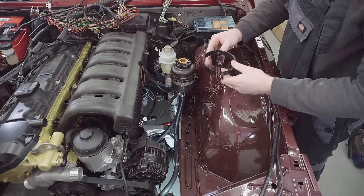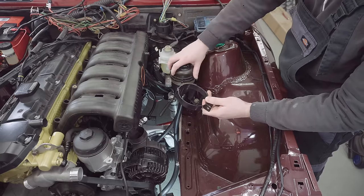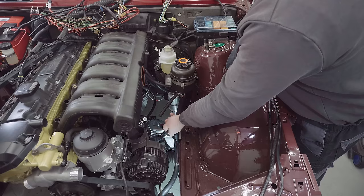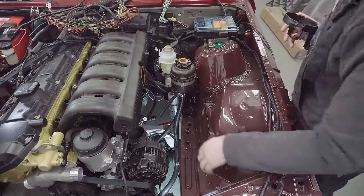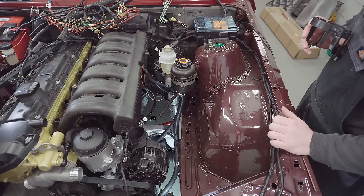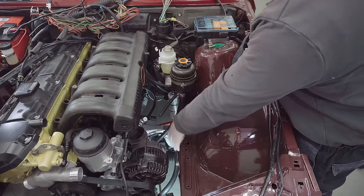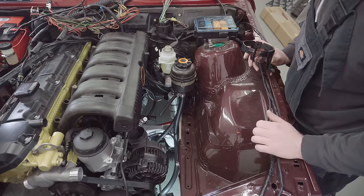So what I'm gonna have to do is what you see most people doing when they do an M50 or an M52 swap, which is moving the power steering reservoir location to the stock location if it was an E36. That's down here using this bracket. Sadly, I've already used the bolt hole on this engine arm to create an extra earth just to hedge my bets on the earth. So that work's kind of gonna have to be thrown away or modified, but I'll figure that out. Moving this shouldn't be such a big deal, despite the fact Dan at BM Conversions has made it for me with longer lines specifically to reach up here. Sorry for wasting your time with that, Dan, but I'm sure we're gonna make it work.